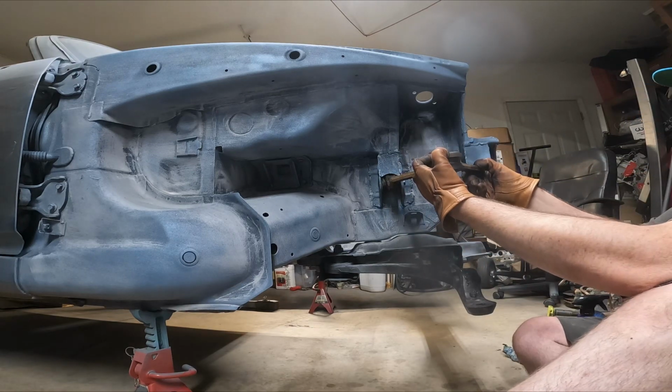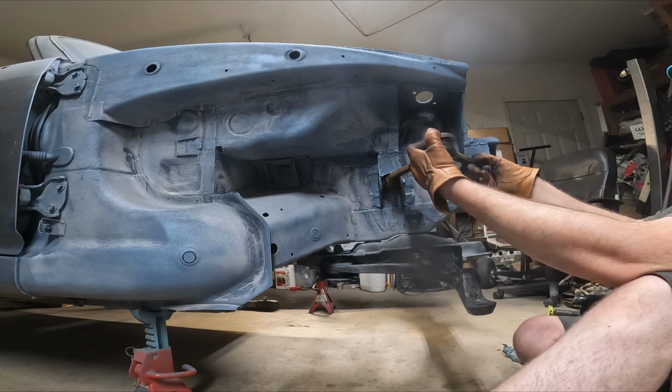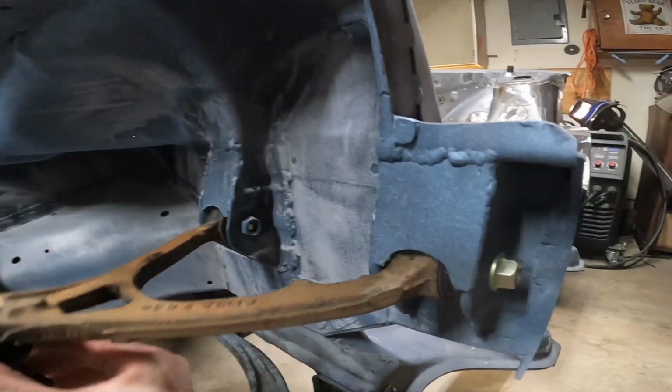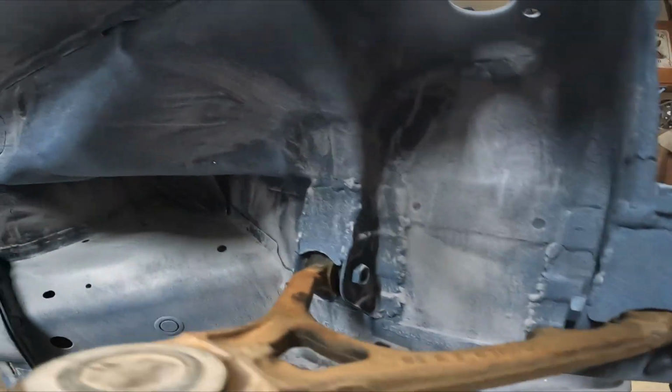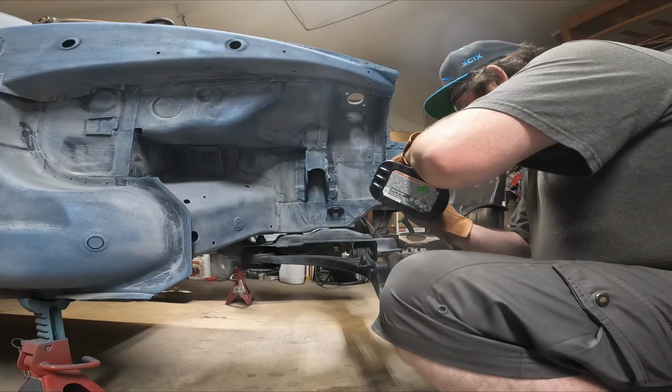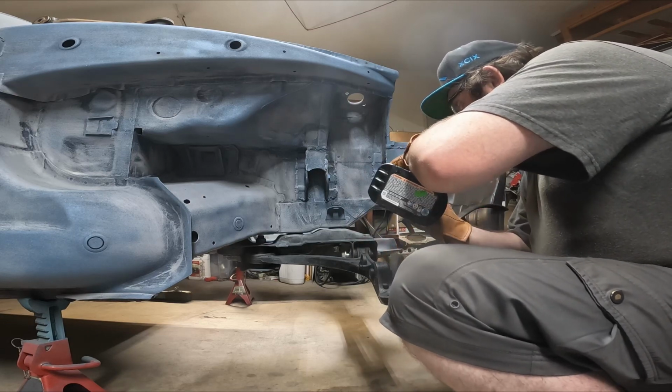After mounting the front control arms, it was at this point I knew I might have screwed up. I noticed that there was hardly any movement when going up with the control arm, and this was obviously going to limit how much actual movement the arms themselves had, and this was going to be a clear stopping point for my range of motion. So I whipped out my trusty angle grinder once again and got to work.